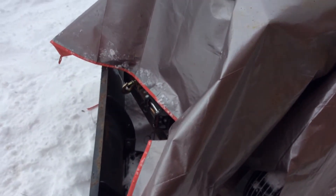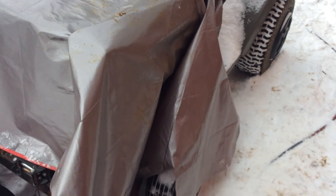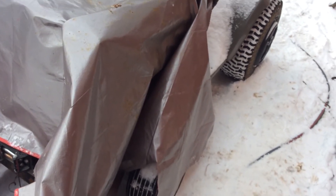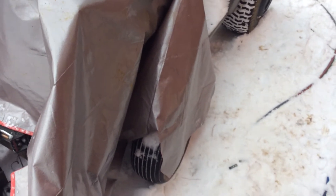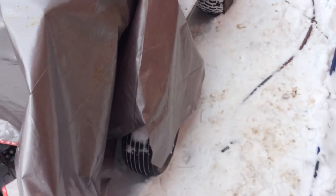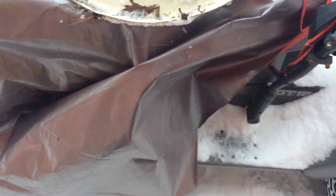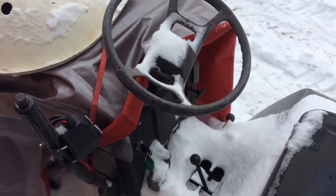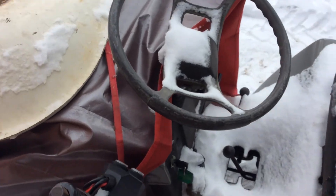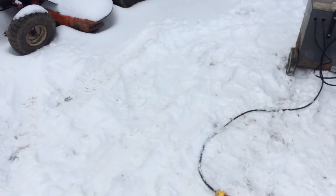I did plow some snow with it — I was going to make a video of me plowing the rest of the snow out, but there's still some on my driveway. Went out this morning, started recording the video, and the starter gear stripped out. To get the starter gear off on these side-shaft opposed twins, you have to take that wind shroud off, and you've got to cock the motor up sideways because the frame's in the way. I've got to unbolt the motor, the belt guard, and the muffler guard. Also, the wiring for the lights is messing up — they were flickering on and off while I was plowing. So I'm going to get a bigger switch, like the 75 amp switch I have on the wheel horse. On this one I think it's only a 35 amp and I'm running lights, a tachometer, and anything else off that one switch.